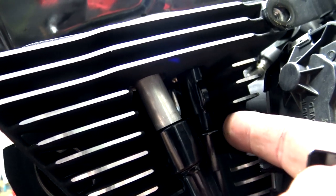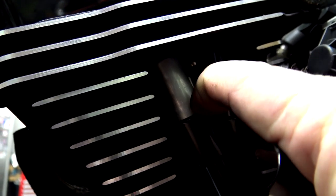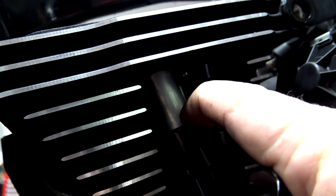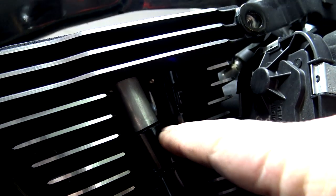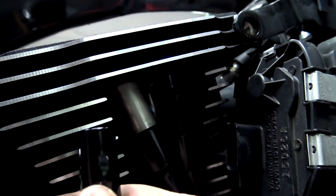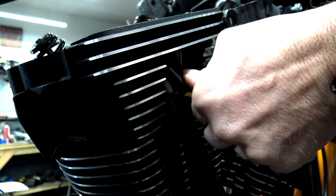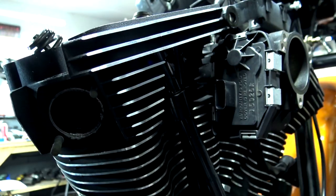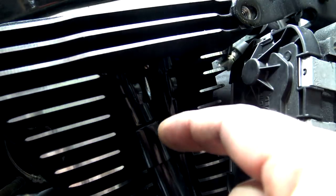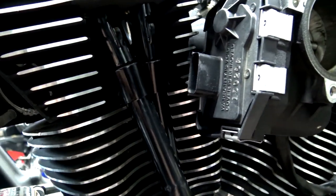To see this a little bit better, we went ahead and did the back one — we're going to work on the exhaust side. You basically have to push this down on that spring; this tube has to go up and remain up. We already have it up with the O-ring seated, but you push this down with this clip. Take a pry tool, set the top, put the pry tool under it, push this down and let it snap on. Now you can see this clip is actually pushing the tube up and seating the O-ring in the top, and it's also pushing this down which is seating the rest of our O-rings. So you have all of that pressure on your push rod tubes now.